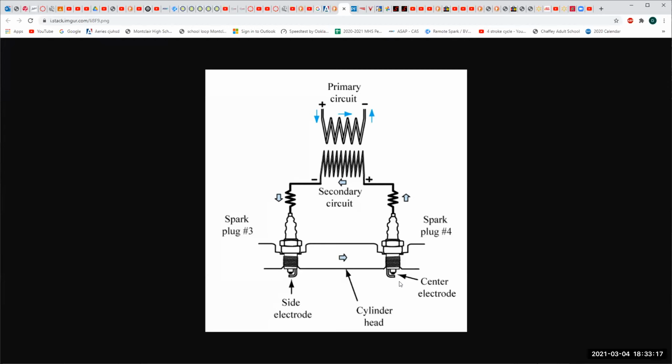All right. So what we see is electronic ignition and distributorless ignition were transitional phases between where we came from and where we knew we wanted to end up. Just like throttle body injection was a transition between carburation and port fuel injection where we knew we wanted to end up. You know, throttle body injection just means that we had 1 or maybe 2 injectors right on top of the throttle body. So it's not spraying for any individual cylinder, it's just kind of spraying. It does have an oxygen sensor,